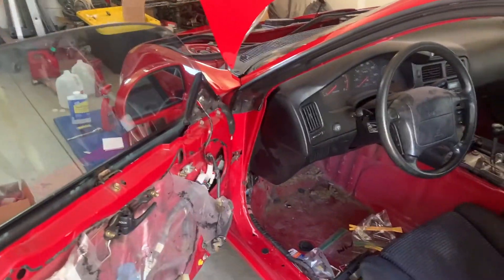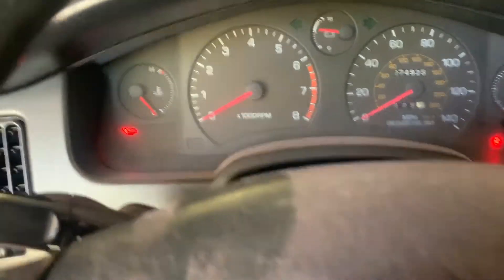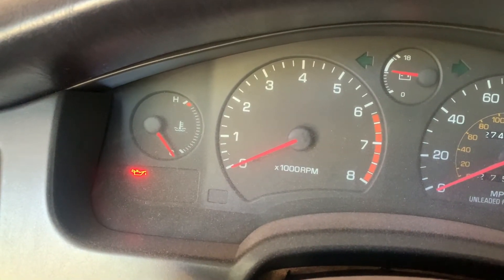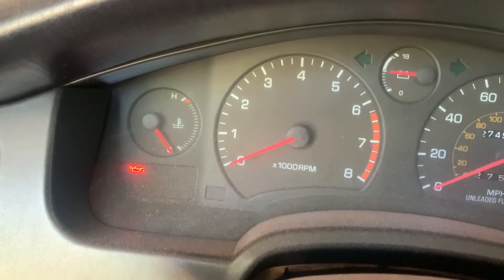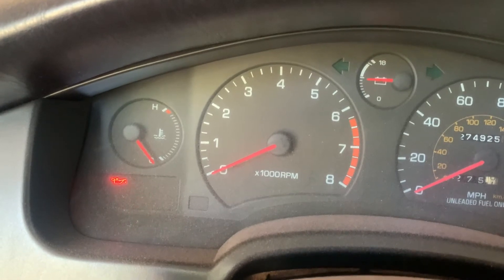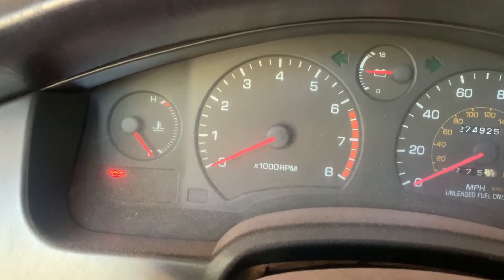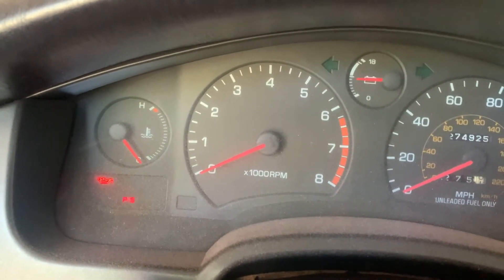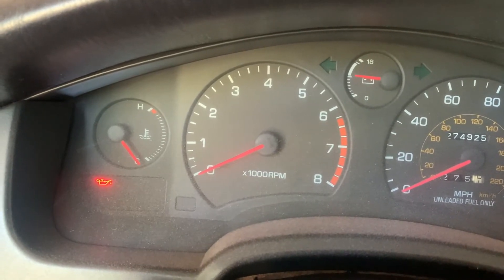Last time I did this, I didn't have the battery connections tight, and so when the starter turned over, the terminal lost connection and I thought I broke everything — yeah, it wasn't good. So key is to get the oil light off. It's still dirty in here, so don't mind the cluster. We're in neutral, clutch in, stuff's on — see if it cranks. It does. Sweet. Come on, come on. Okay, oil light went off.